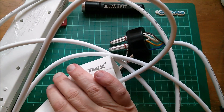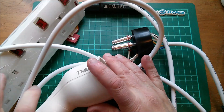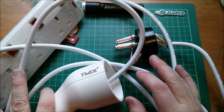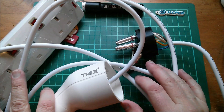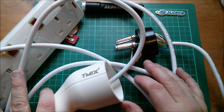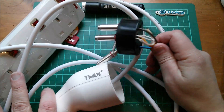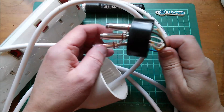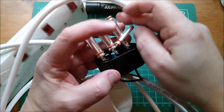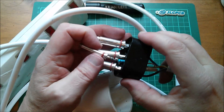Good afternoon. I have a V2L cable which I bought on Alibaba some time ago, before I knew the details of the vehicle-to-load cable for my MG ZS EV. I never used it because while it was in transit — and it took quite a long time to arrive — we found the details of the resistor needed on the PP pin: 470 ohms.